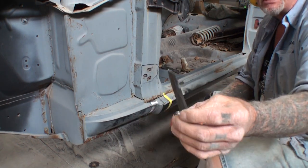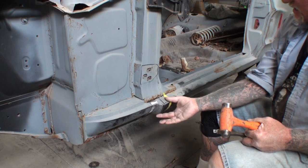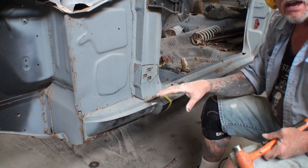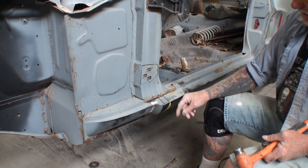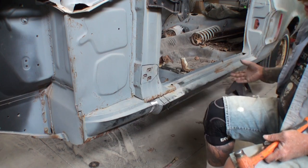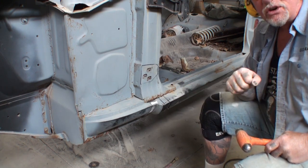I went ahead and sharpened a nice chisel and I'm going to use my hammer — I want to keep all this in real nice contour. We're going to end up butt welding this, so we'll measure at 45, test fit the fender one more time, and then cut the excess off our rocker panel to move it back. If you've come across this before, if you did a rocker panel like this and ended up in this situation, please leave a comment below so I'll know — and everybody else will know — that this has happened before, that this isn't the first time.